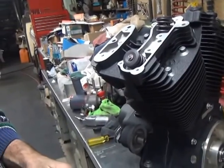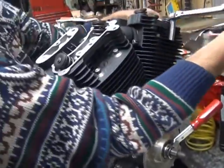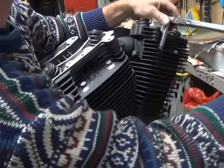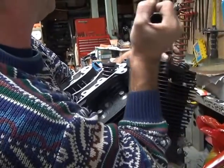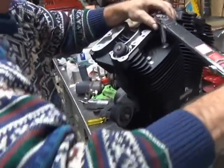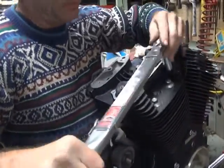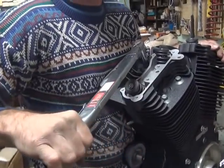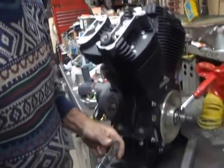Alright. Now if we go to 42. It only takes more pressure to break them away than the extra 2 pounds. See how the torque wrench didn't pop? It should have. Sometimes they do that. That's the problem with clickers. I don't like it when they do that. You can't tell what they're doing. I've had them pulling up 50 pounds, they never pop, even though it's set at 42. Popped it, really. I never trust them when they don't pop right off. You can pretty well tell what your torque is by how you're pulling on it anyway.